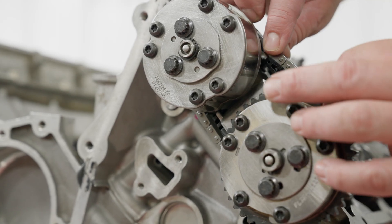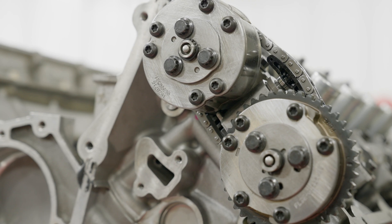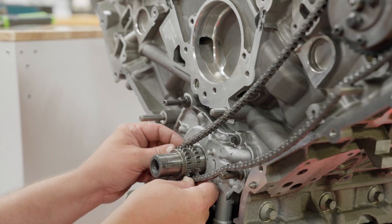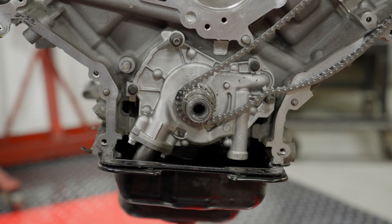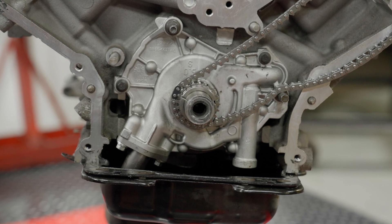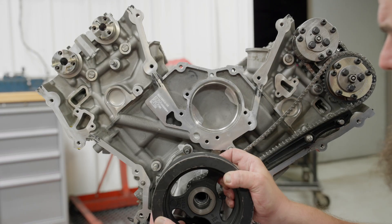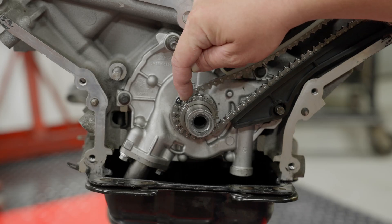Next, make sure that the secondary chain is properly positioned within the ridges of the secondary tensioner and chain guide, then compress and release the tensioner to activate. Make sure you notice the internal springs start to function. Install the new crankshaft sprocket. You can now install the left-hand primary chain. Align one marked chain link to the L mark on the exhaust phaser and place the other end of the chain over the inside row of the teeth on the crankshaft sprocket. The goal is to align the marked link to the marked tooth of the crankshaft sprocket. If the marks do not align, make note of the direction that the crankshaft needs to rotate, move the chain out of the way, and slightly rotate the crankshaft. Repeat this process until the marked chain link aligns to the marked tooth of the sprocket. Once the chain is aligned properly on both ends, install the chain guide, tensioner guide, and the tensioner. Slight rotations of the crankshaft can be made to shift the chain slack as necessary. The tensioner and guide attachment bolts torque to 89 inch-pounds. Recheck the upper and lower timing marks, then pull the tensioner's activation pin.